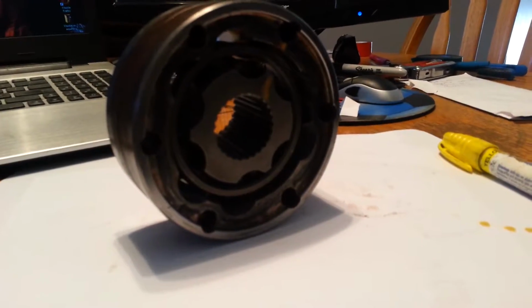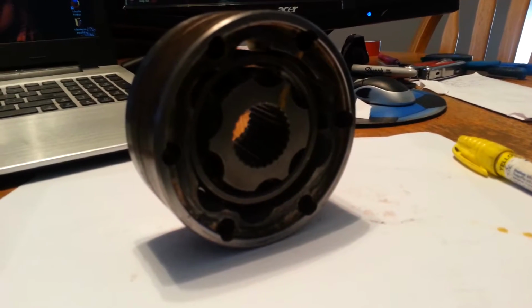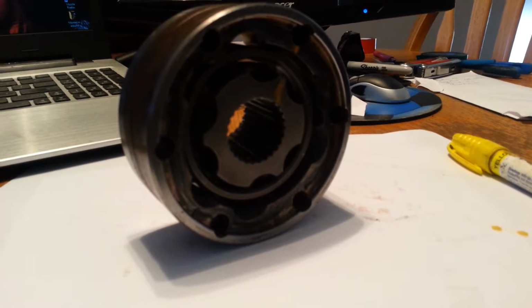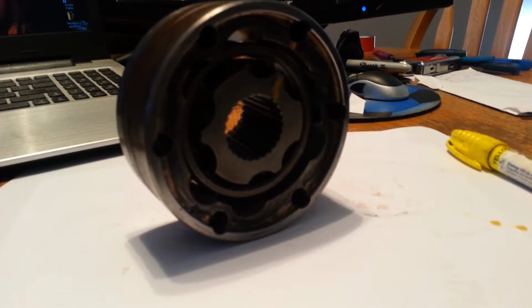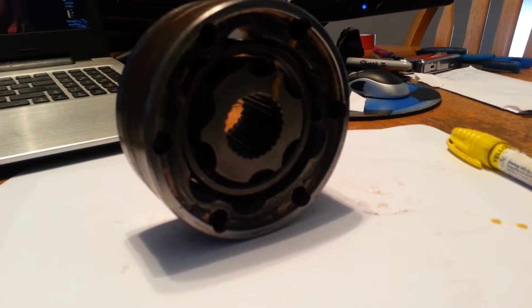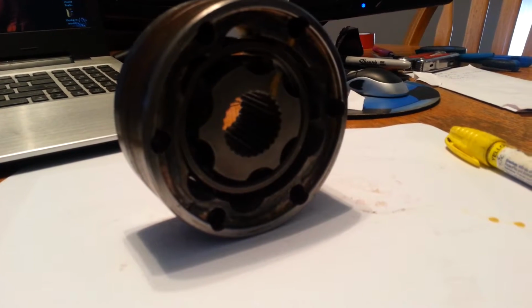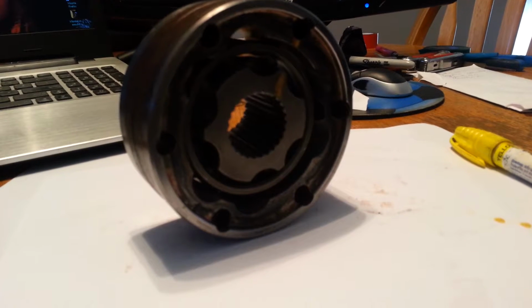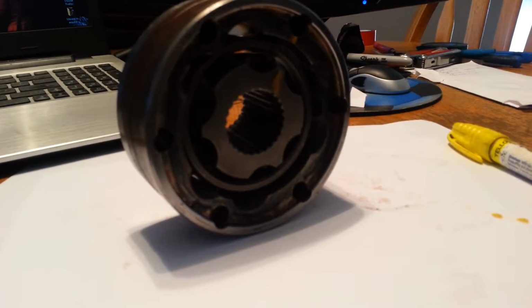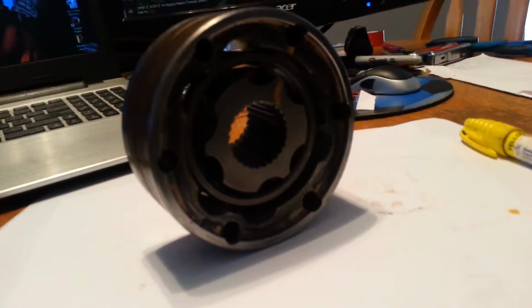You can pull it out to get access to the balls. And the one trick to it will be, when you're pulling those carriages and the gear out, is that you want to keep them as level coming straight out as you can, so that at the very end, maybe you just got to tilt the gear just down a little bit to fit the balls in the ends, and those balls go in these little slots right here. You'll see them all the way around.